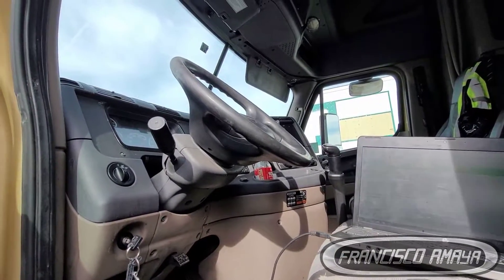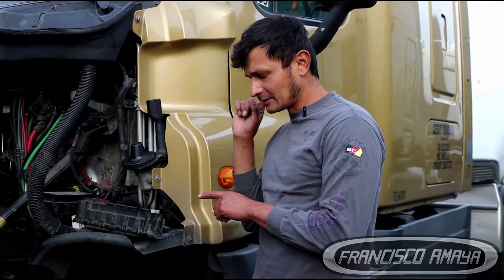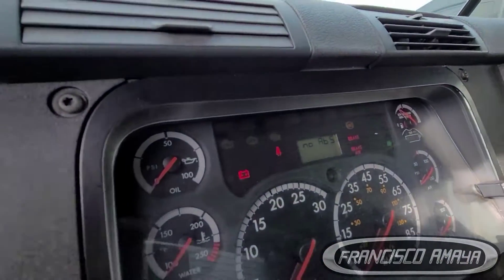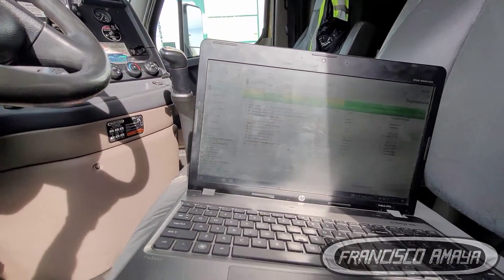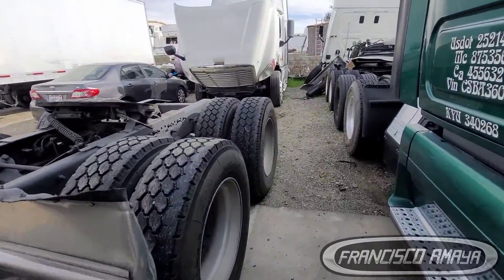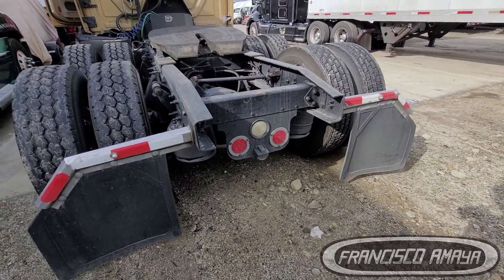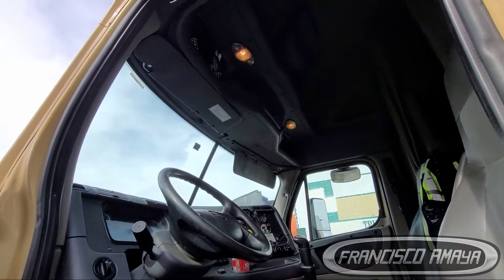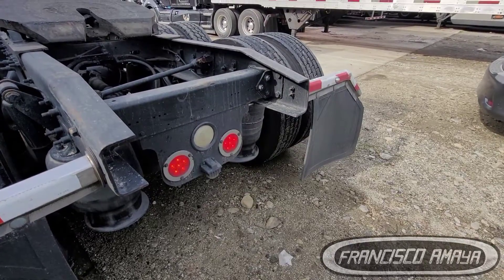It's important to know what kind of problems the SAM chassis can cause so that in the future, if we encounter them, we recognize the situation. With the ignition on, you can see the turn signal lights blinking in the dashboard and the whole module making clicking noises from the internal relays. In the back, the lights are going on and off. With ignition off, no dashboard lights but rear lights still working — that combination tells you the SAM chassis is defective.